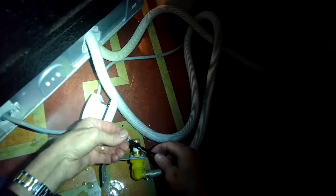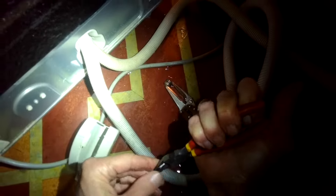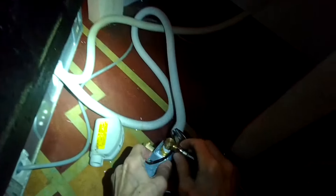We're just clipping around, get that clipped off, and here's the new fill valve. We'll put a link in the description below for ordering this — they're only about 25 bucks. We're going to push it into place and put the hose clamp back on for a nice watertight connection. Now I'm going to twist on the silver fill line — this is the one that comes from underneath the sink, though in this case it comes from behind the dishwasher, which is a bit more unusual. I'm just going to tighten up that fitting. This is a compression fitting, so you don't need thread tape — just put it in position, tighten it, get it snug, and that'll be nice and watertight.